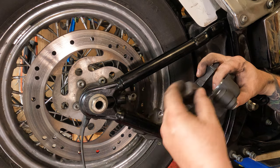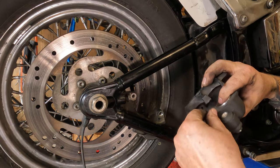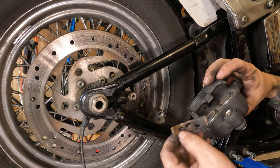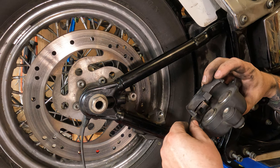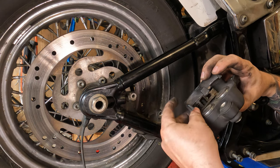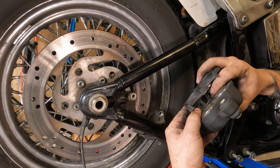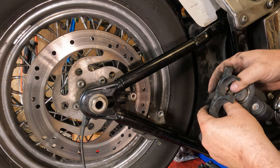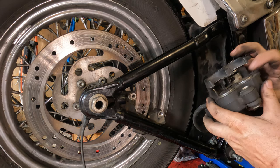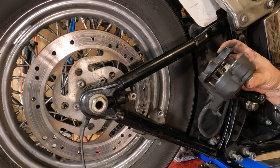Make sure your little rubber anti-vibration plugs are down inside your caliper pistons. This little metal clip is very important — it only goes in one way, which is nice. It puts a little bit of pressure down on your pads and hopefully stops them from squealing when your bike is going really slow but you're not on the brakes. If your pads still do that, you could get a new clip. If they still do it after a new clip, it just is what it is.